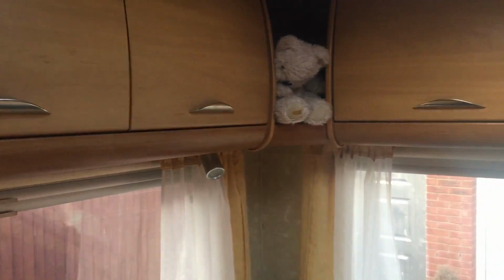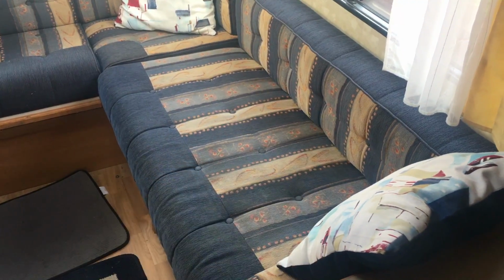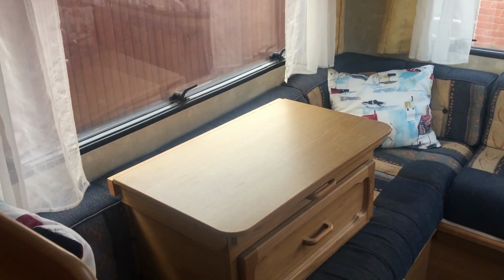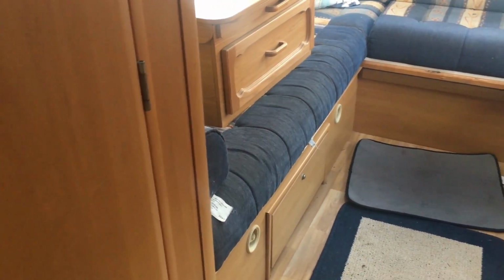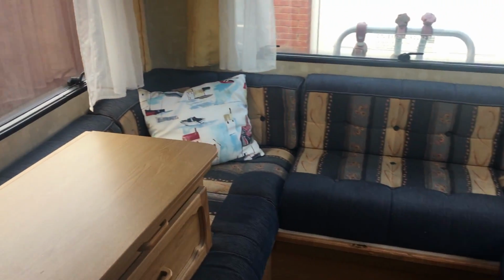So just a couple of things, I've gone through it as much as I could from home. This is a little bit loose, the fly net. The blackout blind is fine and it's opening up fine. Under both sides of the corners, just a couple of inches, there's just a little bit of damp to the corner lip. Well, you could either reseal it, that'll stay like that for years to come, there's no smell, there's no problem whatsoever, all the sideboards are fine on both sides, or you could actually slice it in and reboard a tiny little piece there, depending on your fussiness levels. But no, all the floor's solid, she's fine. So as I say, that's up to you if you do it or don't.